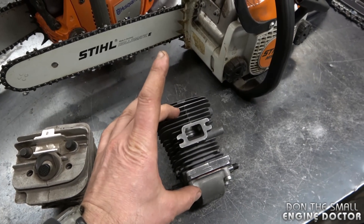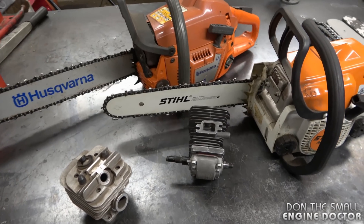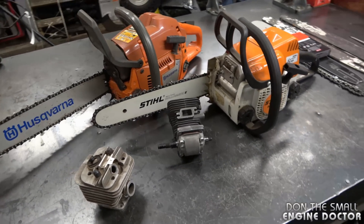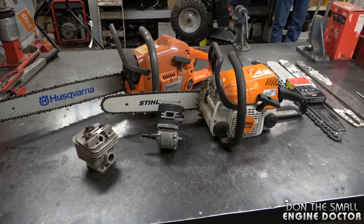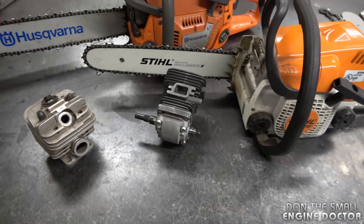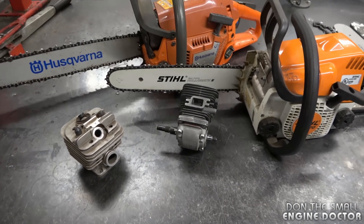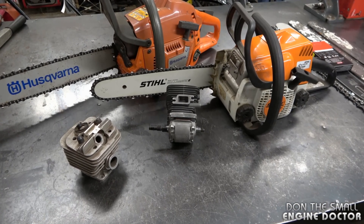If you want to verify it's an OEM kit, look on the sides and underneath the cylinder block for markings. I'm mentioning this because I see a lot of people posting saws online claiming freshly rebuilt, and I know from the price there's no way it's an OEM kit — an unsuspecting buyer ends up with problems. Try to steer away from cheap Chinese kits; I'm not saying they're all bad, but do your homework and make sure they're Nikasil-coated. I also recommend buying a new chainsaw instead of a used one if you can afford it. That's it for today's Q&A — thanks for watching, and follow me on Facebook, Twitter, and Instagram. Have a great day!